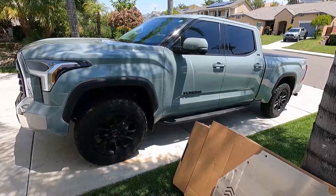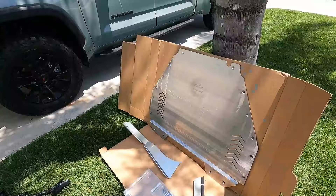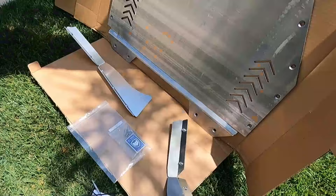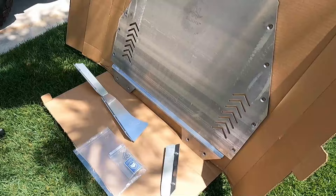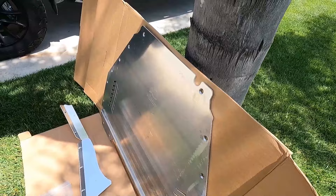This is actually a TRD but does not have that TRD skid plate. If you do have the skid plate, they're going to send you two longer bolts because essentially you're going to sandwich that in underneath the TRD skid plate and connect the two together. In our case it should be a pretty straightforward install. You can simply unbolt it if you ever need to remove this for any type of service — transmission service or anything like that. It is just a bolt-on. These do have the security bits — looks like a five-point, similar to a Torx security type of bit, which would be a lot harder for a thief to find. They do send that bit, so just hold on to it and make sure you don't lose it.